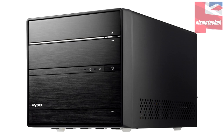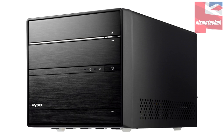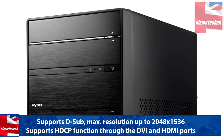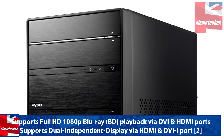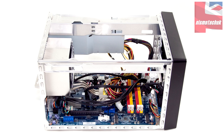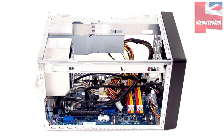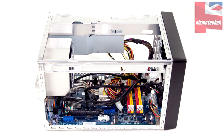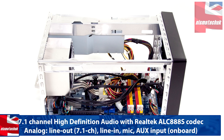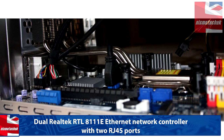The system itself is more or less pre-assembled — the cabling is already done, everything is in place. It's really just a case of installing a CPU, RAM, and hard drives. The airflow inside has been specially arranged so components are in specific locations, preventing heat build-up that could affect stability. The heat pipe cooling technology Shuttle has implemented for the CPU effectively gets rid of heat immediately, rather than recirculating warm air inside the case. The system is made from lightweight aluminium — very strong but particularly light — with dimensions of 33.2cm length, 21.6cm width, and 19.8cm height, weighing just 3.5 kilograms.